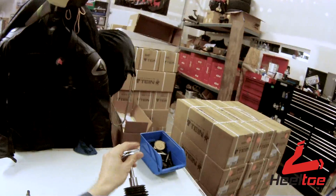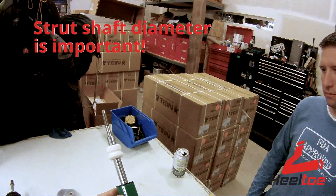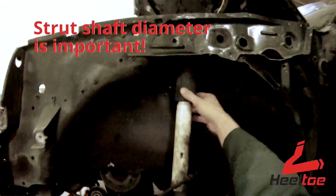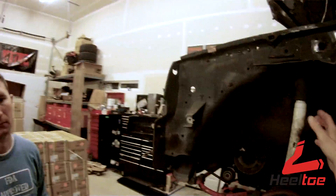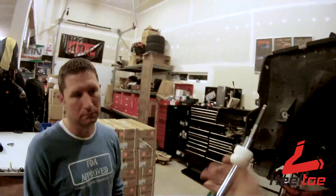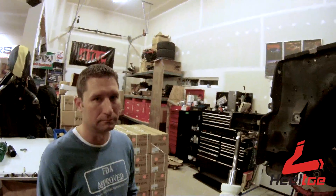Typically the shaft diameter is 10 millimeters, but you can see with this one there's a huge shaft. That's because it makes the whole assembly more rigid. This is a Tokiko shock — it's 10 millimeters also and tends to be the same diameter all the way down. While it's adequate, it's not as performance oriented because it doesn't have as big a diameter. We designed this one to have a really big shaft diameter because it's very rigid. With less deflection, you also have better seal wear.